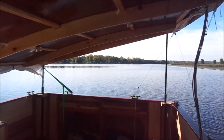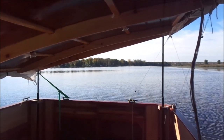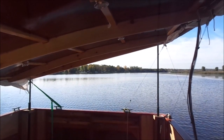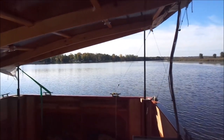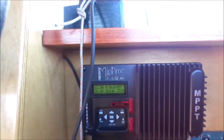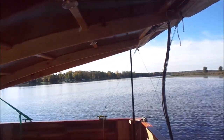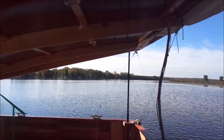It is now 25 after 10. Because it's fall, this is probably equivalent to about 20 after 8 in the morning on July 1st in terms of sun position. So this is a good representation of leaving early in the morning and getting underway. Right now I'm getting 333 watts on the top controller and 248 watts on the slave controller — so about 550 to 600 watts so far at this time of morning.